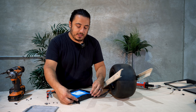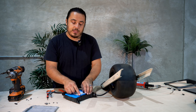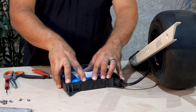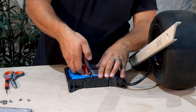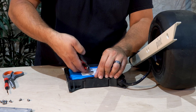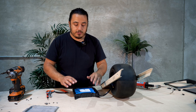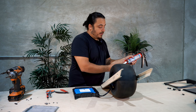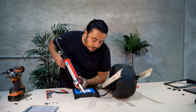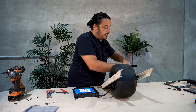The reason they might have done that is because the O-ring might have been a little bit too long if it was already previously installed. You might have to do the same thing on this side as well. If this O-ring isn't going to want to sit in place and you have a good amount of length left, just take something to snip it and let it lay flat, then cut off the same length that's overlapping — that's going to make your install so much easier. You cannot forget to add a nice little dab of silicone where the two ends meet.